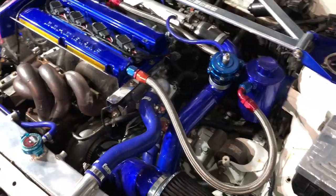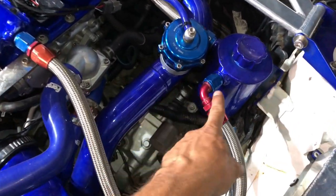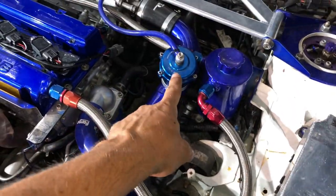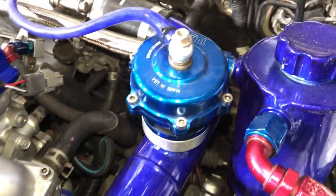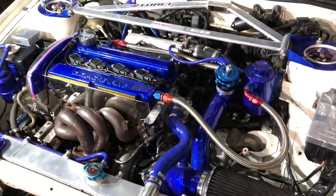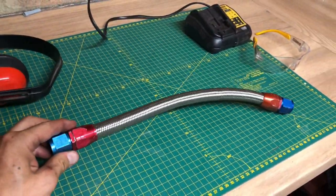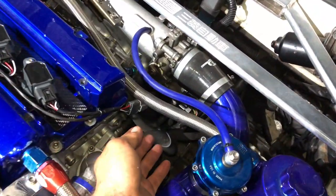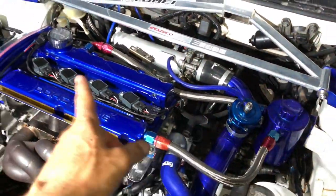This breather line here has been really bugging me - there's no idea why it's got such a big right angle bend. I want to shorten it so it just goes straight from here to there and get rid of all the nasty excess line. I've also got a fitting for this. The dump valve is getting deleted as well because the spring pressure is too low in it, and this big turbo can handle a bit of chatter anyway - so we're going to blank that off. That's the little dinky line made up - I've cut off so much that I could nearly make another line from the excess. It's now fitted lovely and doesn't go all the way around the engine bay anymore. One annoying thing is the hose is about half an inch too long so it's got a slight kink in it - I'll probably end up trimming that down.